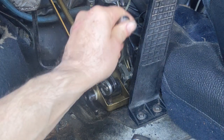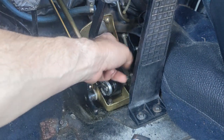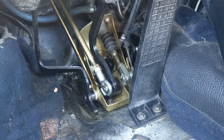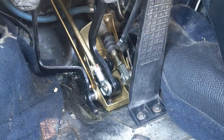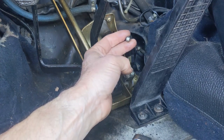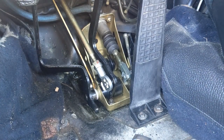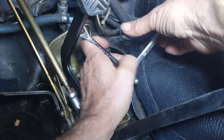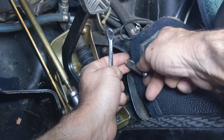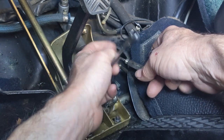So this is the clutch adjustment. I'm going to move the clutch pedal further down with this adjustment. I'm going to move this push rod two full turns and see how we do - back that nut off a little bit. The pedal stop is all the way forward, but we can loosen these lock nuts on here and make the pedal throttle linkage arm longer. So that's going to bring the pedal out closer to the brake pedal. We want these two to be even when the brake is pressed. It feels like that's several turns, so let's try that.